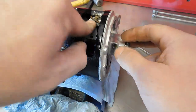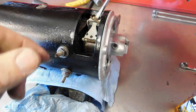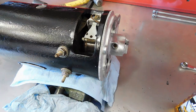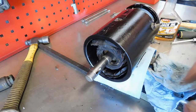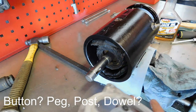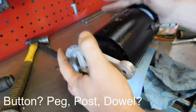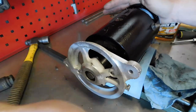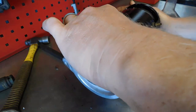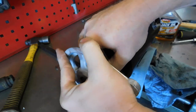You can see the brush snap down. Just want to make sure that the end of this spring-loaded tab is pushing against the very end of the brush, so they are being held down. On the front frame we've got a button on the case and a hole on the frame. Make sure you have this shim in there.